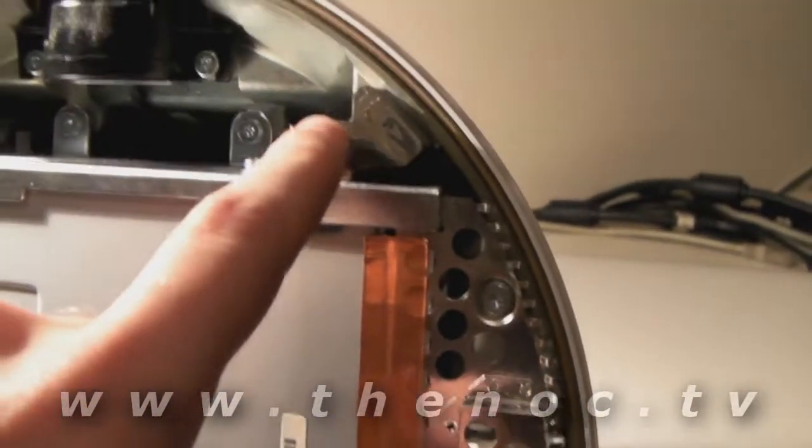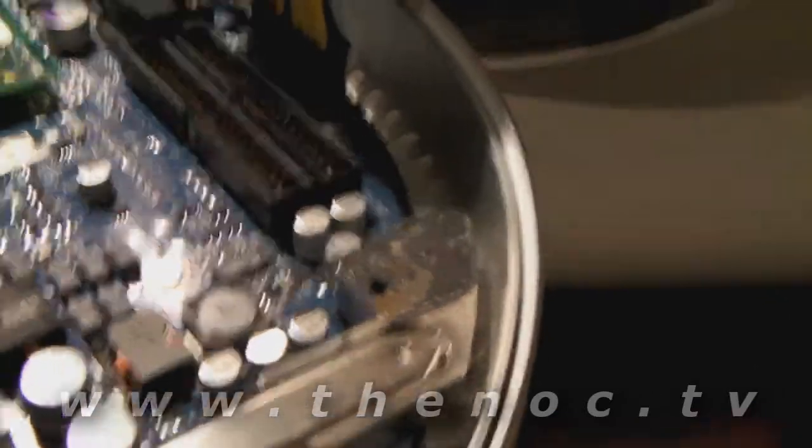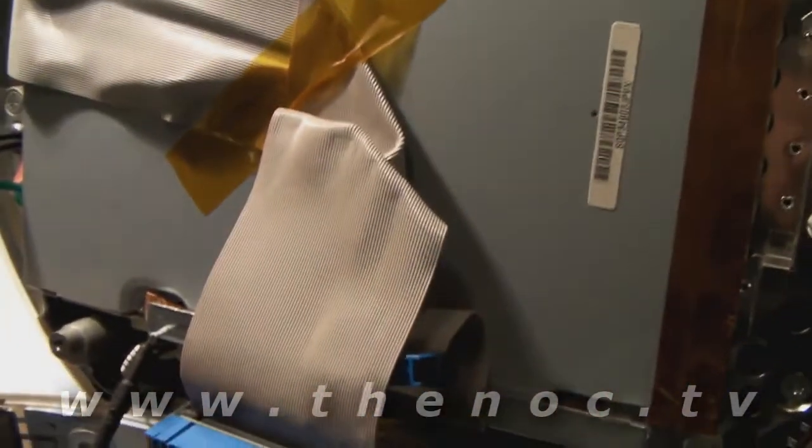What I like to do is clean these off — take an alcohol rag and rub each one of these contact points to clean them. Just a little bit makes them nice and clean to form a good solid connection. Then screw it all back together. I wanted to show you that before connecting these two up and performing the cleaning. Once you do that, you can slide this whole top back onto here and tighten it down.